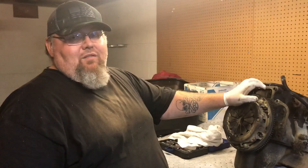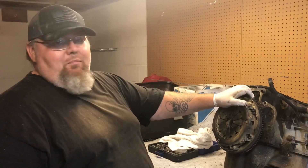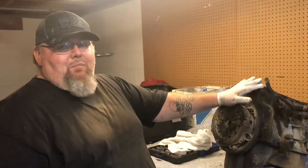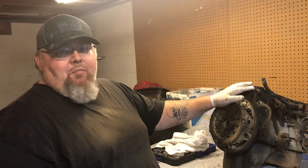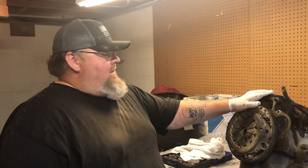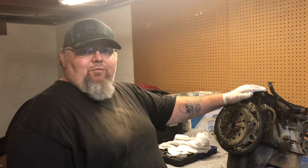From what I understood about this truck, it was a very low mileage vehicle, but upon disassembling and pulling the head off, we did find a crack in the head and a lot of play in the pistons. So what we're going to do is go ahead and tear it down, get it off to the machine shop tomorrow, get it all mic-checked out, and then get some parts ordered up, and see if we can't get this thing back together and back on the trail in a reasonable amount of time.